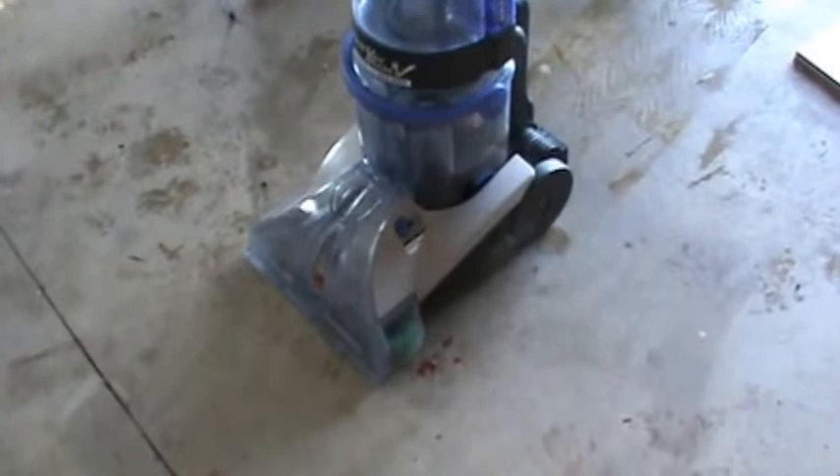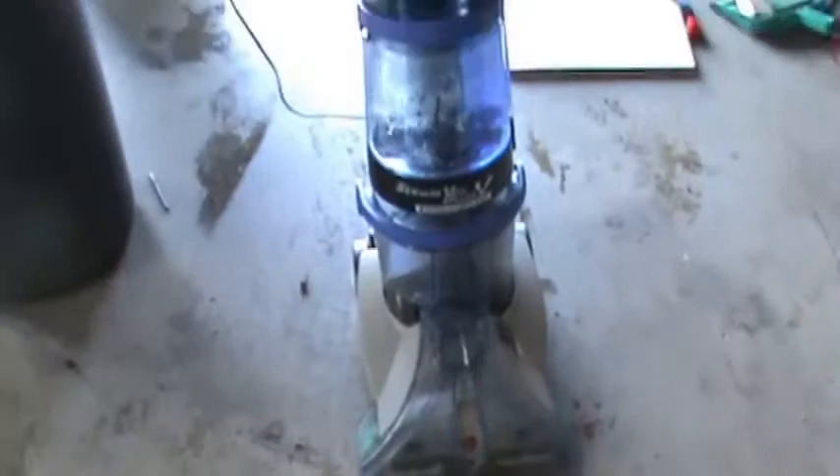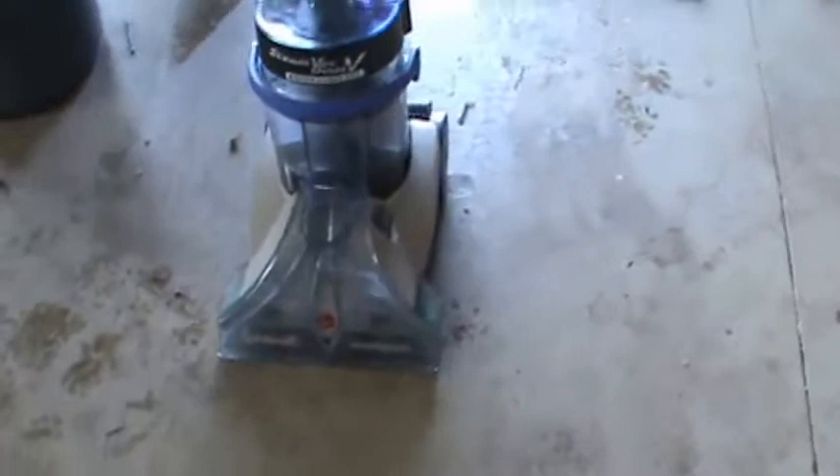It seems to be working as it should. This is the type of thing that happens with your steam vac — it works fine, you put it away, a month later you pull it out and it doesn't work. The reason is the moisture and water in there rusts up those bearings and then the gearbox won't work. You can just loosen it up a little bit and you should be good to go. I'm DoubleWide6 — hopefully you enjoyed this video. Check out my channel, I've got a bunch of other repair videos. Thanks for watching, any comments I'd appreciate. Take care.